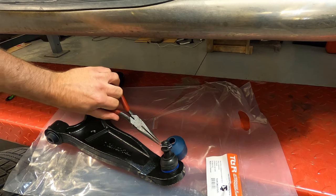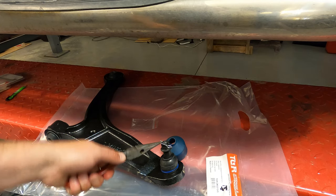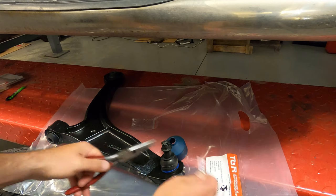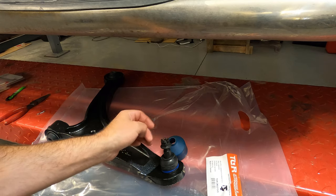To get the pin off on the truck, you might need some pliers. You've kind of got to pry it out and up — it's a little bit awkward — out and up, and then it can come out. Get the old one off the truck, then you can remove the old castle nut and proceed with pressing off the ball joint.